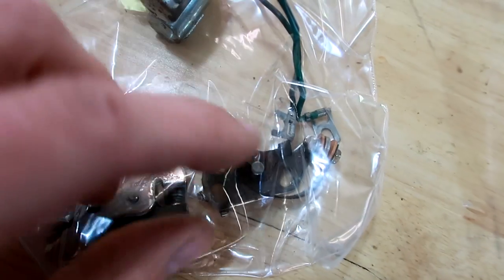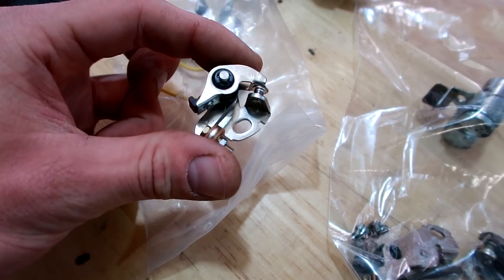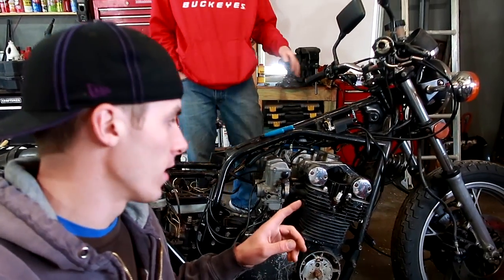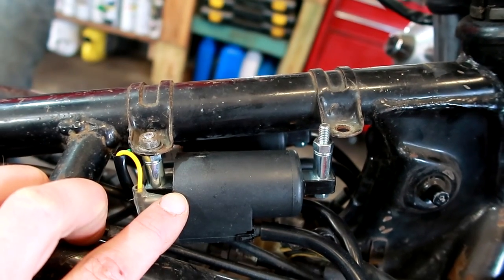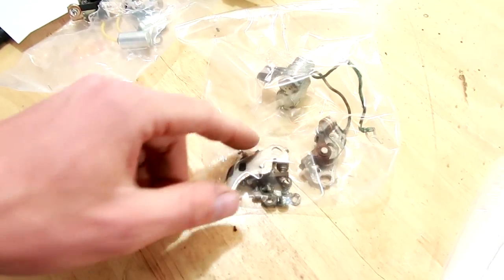Let me show you. Here are the original parts to this bike. As you can see it has two holes for two screws to go into, where the new parts I purchased only have one space for a screw. Also the condensers are different because they each have a screw. Along with the coils — now hopefully we got the right coils. I'm not very impressed with the box it came in because it says Kawasaki, but on the receipt it says GS1000, which this is — this is a Suzuki. I was hoping that by punching in the year and model I could find the right parts, but as you can see this doesn't directly bolt in. I think I'm much further ahead by sending the other ones back and using a similar style to this, otherwise I'm going to be out a lot of time and I just want to get this engine running on all cylinders.